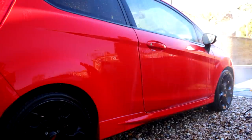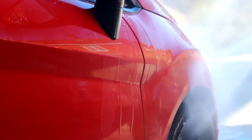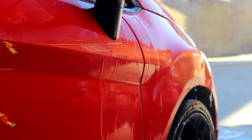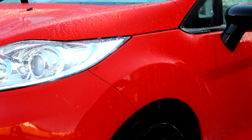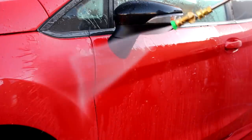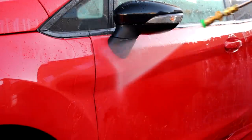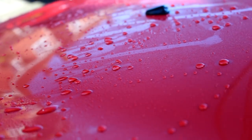We've also swapped to the MJJC lance — there's an affiliate link below so every time you buy one you'll be doing me a favour. Let it dwell now. I don't think I allowed it to dwell enough on this wing — water behaviour is certainly improved but on this side it's amazing. Should have let it dwell a little bit longer, so I know I'll get picked up on that in the comments. The more you rinse this product off the better it is — that goes for all wet coat products. Do not do it in the sun. Some nice bead shots and we've got some protection on the paint, which is brilliant, and it's looking glossy.